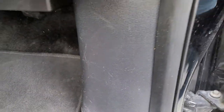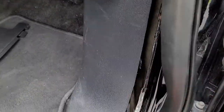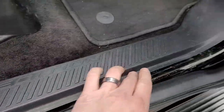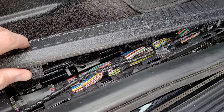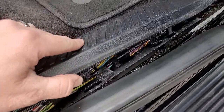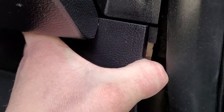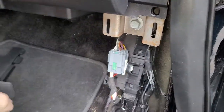First, you're going to want to grab this kick plate and just pull that piece off right there. Second, to make this really easy, you're going to want to take this weather stripping and pull it all the way off. You're going to have to pull it all the way back because the whole kick plate has to come up. There are just a couple of quick release tabs, and then a quick release tab up here as well. Be careful not to break that tab off, and then that piece comes off just like so.